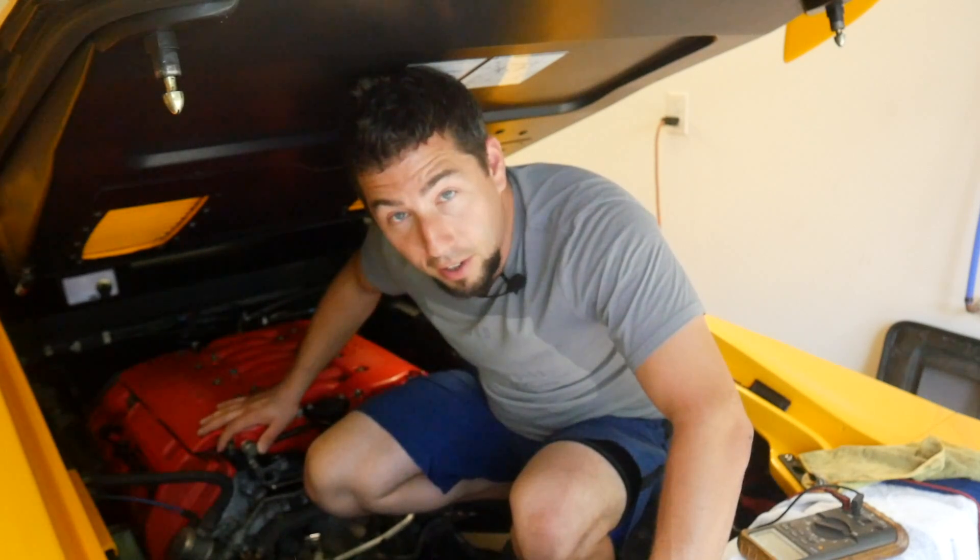I was pretty upset. By checking which cylinders were dead, I discovered that there were two dead, which was interesting to me. Each coil pack — they're in the valley — each coil pack feeds each bank, but they're opposing. So the coil pack on the right bank feeds the left cylinders, and the opposite is true as well.